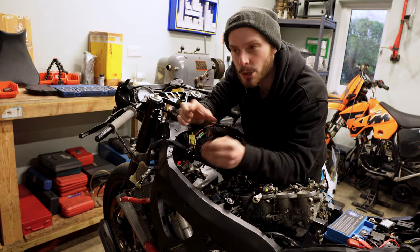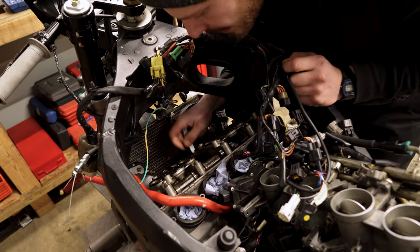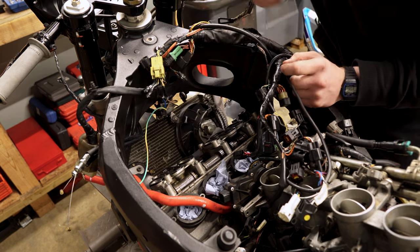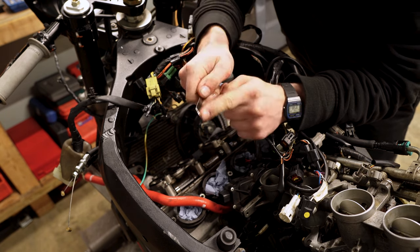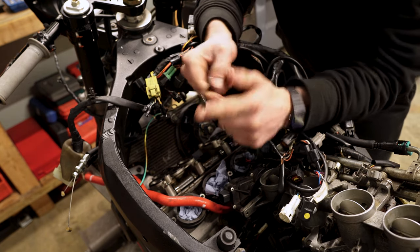If you try the one below, the one above, and the one you think it is, you'll get a feel for it. This 45-degree feeler gauge set is perfect for the exhaust camshaft — it allows me to get around the back and get a proper reading on the flat surface. If you ever use 45-degree ones, never push past the angled section as it'll give you a misreading and can actually bend the shim. Only use the flat section — the angle is just there to get access.